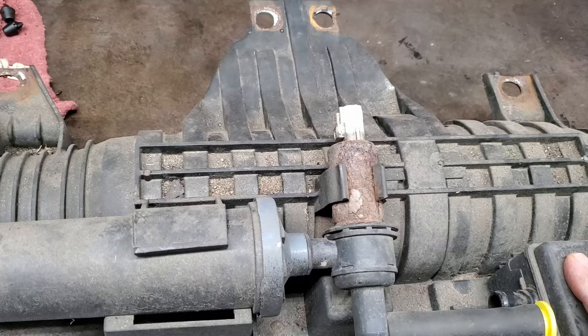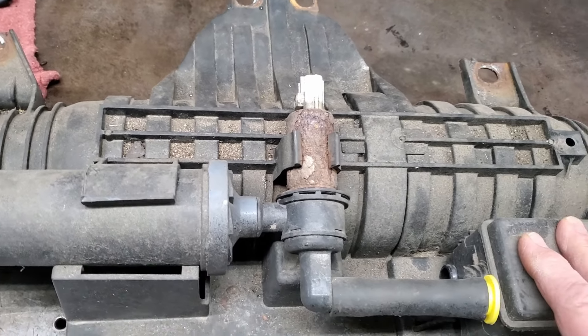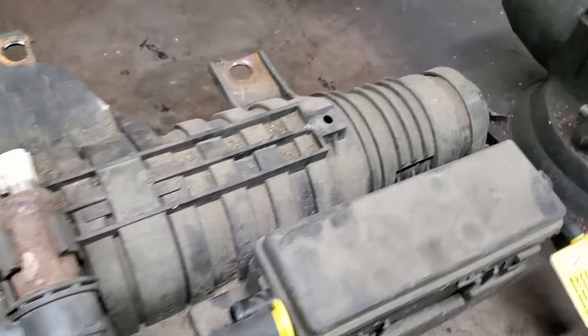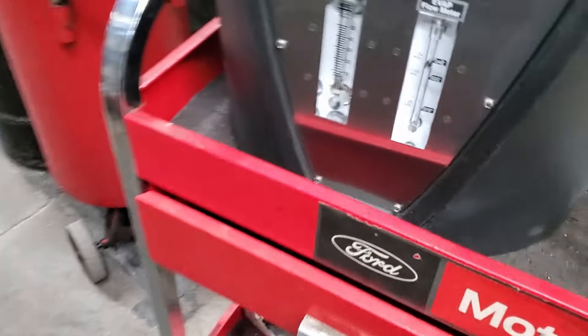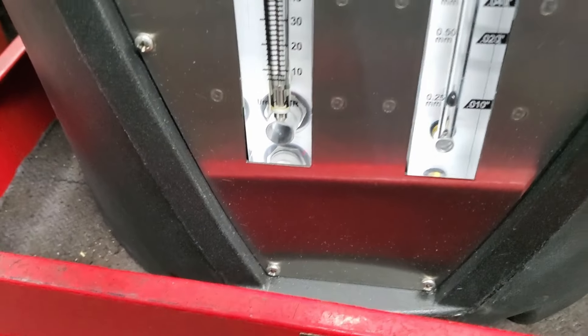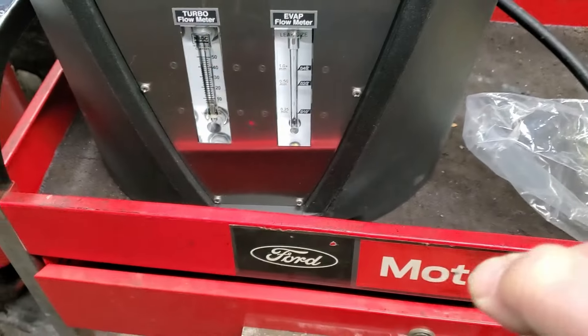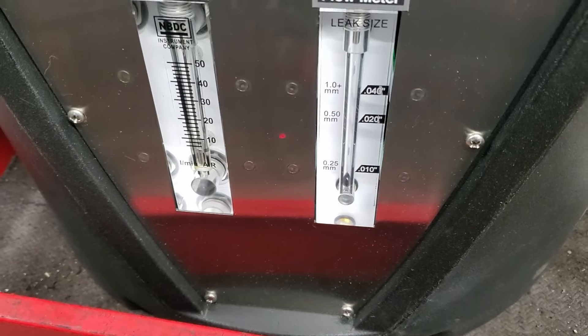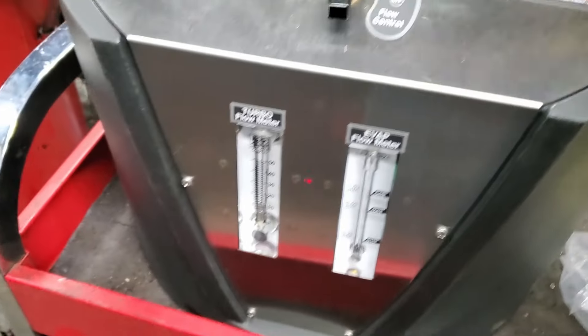We'll make this work. Now we can hand it back to the customer with confidence and say yes — we verified the leak, we've proven it up here on the bench. Eventually, if I let this run long enough, watch the pressure indicator — it's going to go down just like that. That's a sealed system. Right now I'm holding my finger over the end of the hose just trying to demonstrate — smoke checking is a low pressure system test.